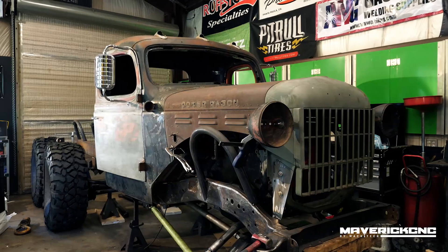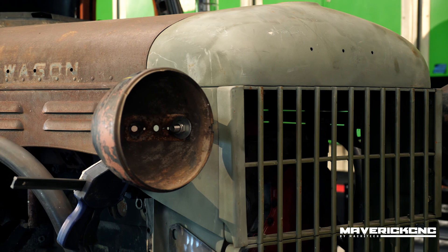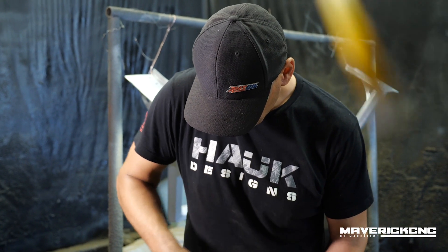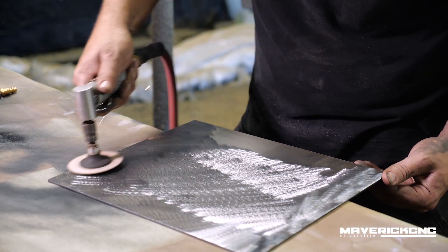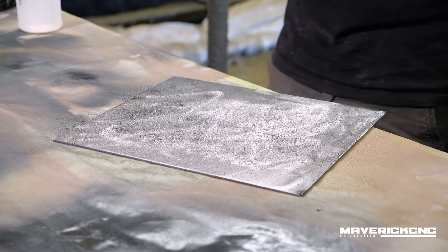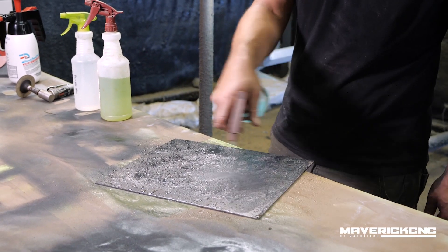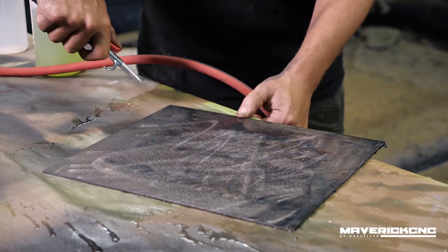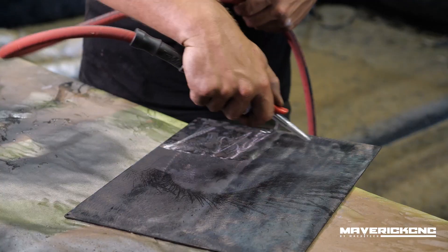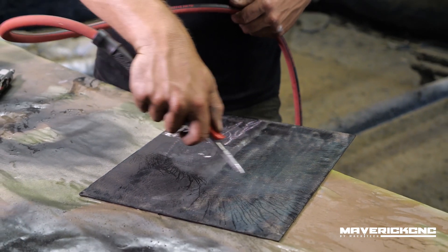I found a product that I really like to use called Metal FX. I've been playing with it, trying to get different effects and looks. Sometimes the patina that comes naturally is good, but if you're getting body panels from different trucks, they don't match — the patina is all over the place, this is brown, this is green, this is blue. So what we decided to do was take everything down to bare metal, spray a chemical treatment on all the body panels, neutralize with water right away, then clear it with a satin clear. That's going to give us a nice even appearance that looks weathered and aged, but it's all brand new.